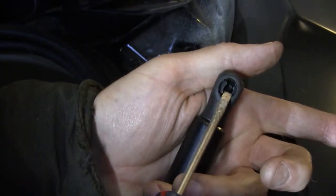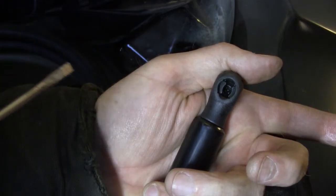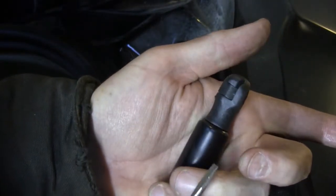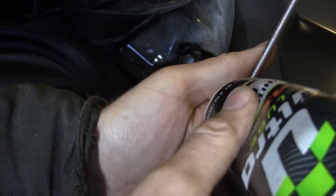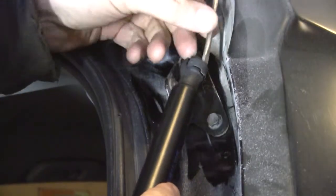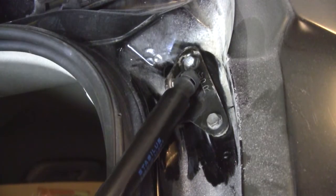Now we are ready to put our struts back in place. You can see the little claw on the inside — what we want to do is pull that back. I've seen guys just jam these on and get lucky, but I've also seen guys destroy these ends by jamming them on because the claws bend in instead of pulling back. If you flip this to the back side, there's a little slot. Take a small screwdriver and put it underneath that slot — now those claws have pulled back. I also like to put just a little bit of lithium grease in there. It doesn't take much, and it's not going to squeak or rust. Just bring it around, put it up into place, pull the screwdriver out, and the clamp grabs hold. We'll repeat that on the gate side.